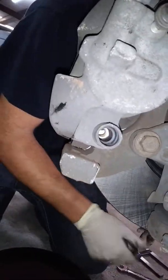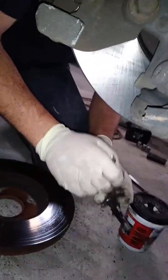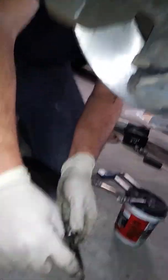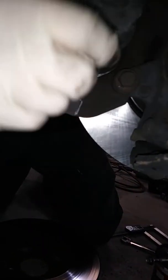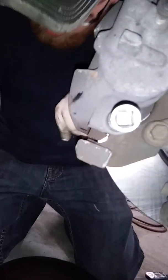So you kind of almost want them, well, not loose, but don't put too much fight in it. Yeah, not like we did that 15 millimeter bolt because it's a lot thicker threads. Yeah, you can see these are real fine threads, and they can pull out if you're not careful. Gotcha. Yeah. See, we gotta start it by hand. That way we don't cross thread it. See, I'm starting to cross thread it now, but I can stop because I know. You can feel that with that big ratchet on there. Exactly. See, once we got it started like a couple turns like that, then you can stick your ratchet up there.